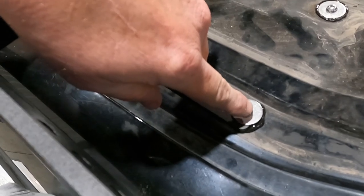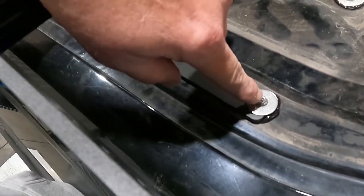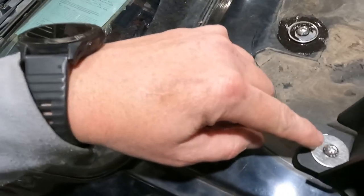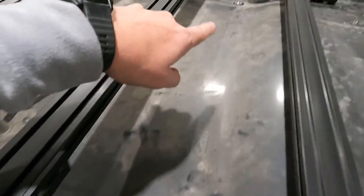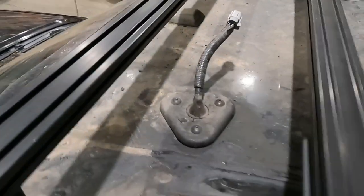You're going to need to gain access to these holes at the front of the vehicle. If you locate the drip rail — I'm on the driver's side here — follow down this line and there are three holes to the outside of the vehicle. On the interior there's one here, one on the other side, and at the front by the windshield there are four bolts that you're not going to use. Go ahead and fill those with silicone and put the existing bolts from your kit in just to seal those up so you don't get any moisture into the interior of the vehicle.